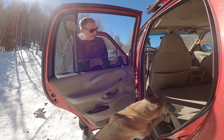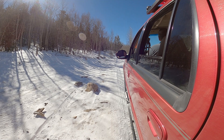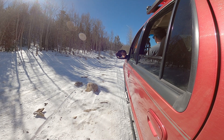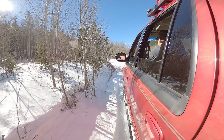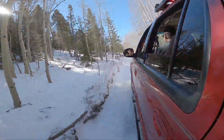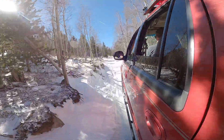Let's sum this up. If I compare a TrueTrack to any type of clutch limited slip differential, it's better in the rocks because you can make it lock. It is better in the deep snow because it hunts for grip in a different way, and it's about the same on the street — pretty much invisible and works when you need it to. When you compare TrueTracks to a locker of any type, whether that be a Detroit or Grizzly lunchbox locker with a ratcheting style, or a selectable locker, the TrueTracks don't do locking as well as they do.